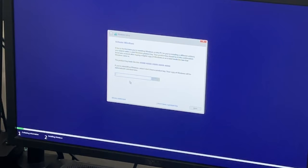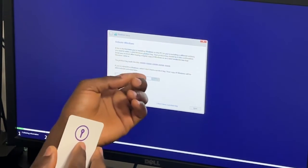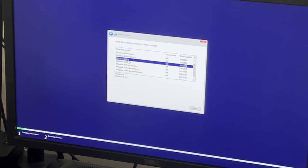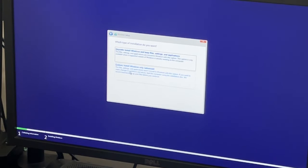I have a product key — this is what I purchased. I hope you guys don't steal it! I purchased this Windows 10 key. You can enter the key now or finish the installation and activate later — I'll skip it for now. Then choose which option you want. I like to install Windows 10 Professional. It allows me to connect to a domain. Pro, Pro Education, and Education all have the ability to connect to a domain. Here I select custom installation, not upgrade.